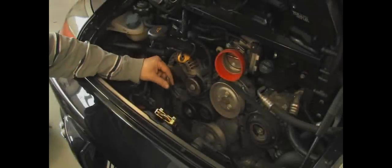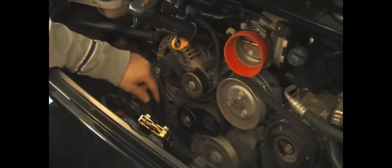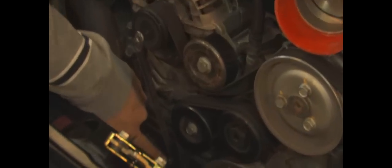The next step is down here you can see a bolt right here — we've actually loosened that. This is the existing bolt on the block just above the middle of this pulley, and then this stainless steel support rod goes in there. You use that bolt, put the support rod in there and tighten that up — that's a 10mm nut. Now that we have this support tube in position, leave this bolt just slightly loose at first so that it can move around a little bit.